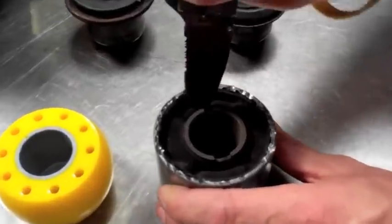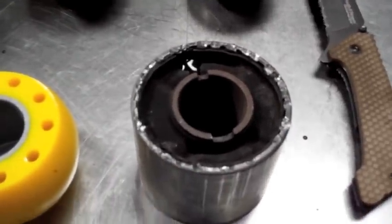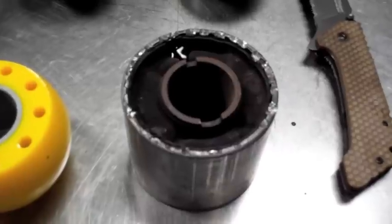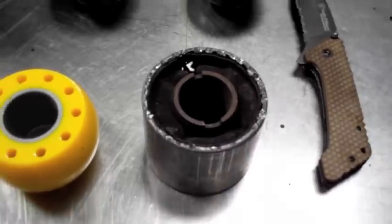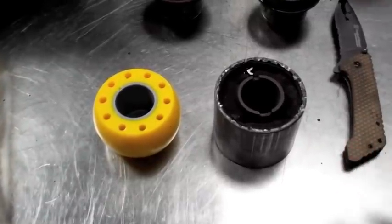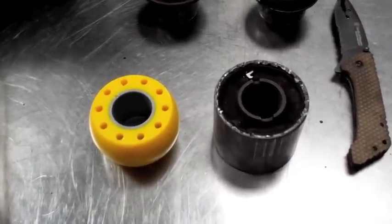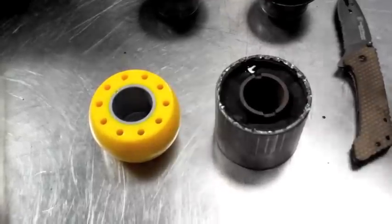The reason why is that that bushing is oil filled. So when you go to load up the rear power to the rear wheels, this bushing will actually comply with that, meaning it has some give in it. If this bushing pops, it will get even more slack in the rear diff mounting setup.